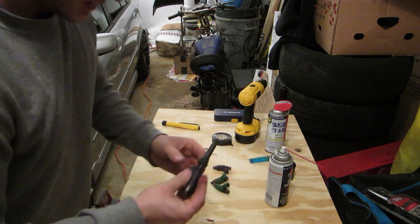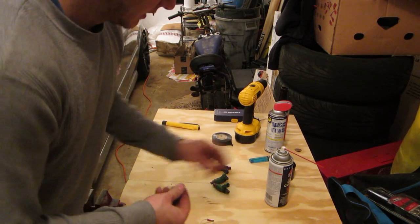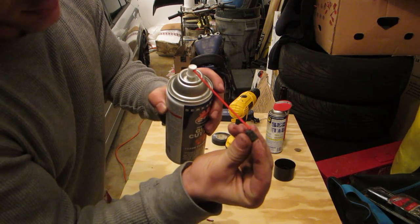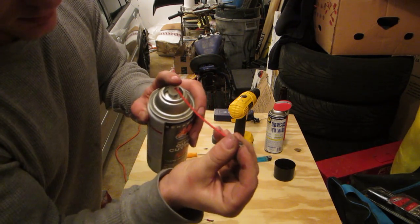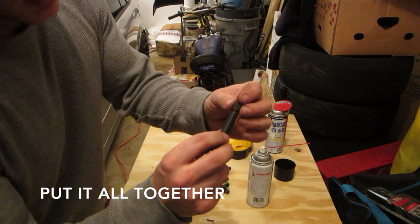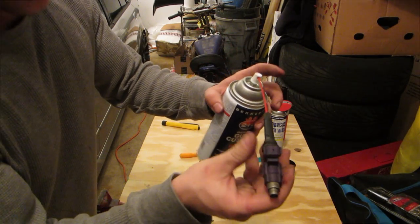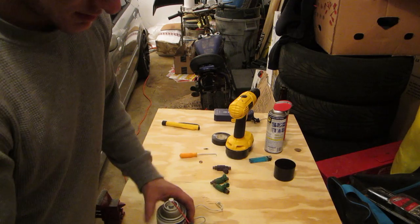Like so. I would suggest wrapping some tape around there just to be safe so this doesn't pop off on you. Then you take the valve stem cap and you drill a hole in it, just with a drill bit, about the size of the straw so the straw can go through it — but you don't want it too big because you want the straw to be snug. So the straw's through it, then you put that on there, put your straw through, and you have now made a pressurized system. So then you squirt this while you activate the fuel injector and it'll squirt through.